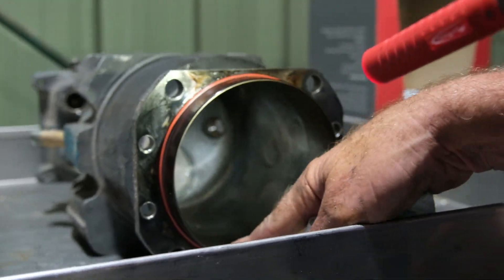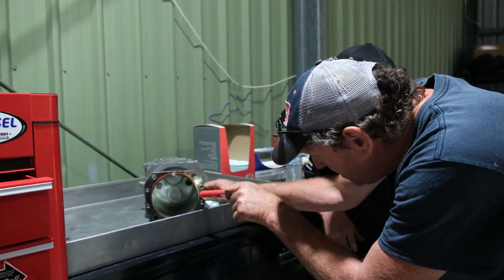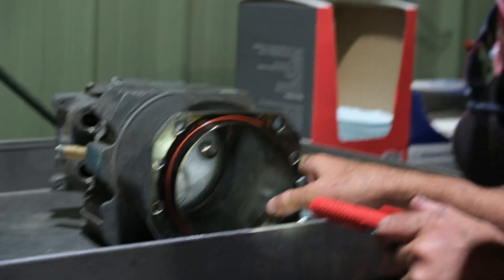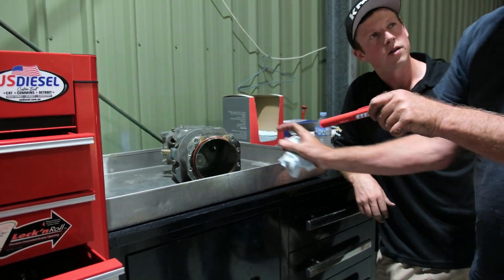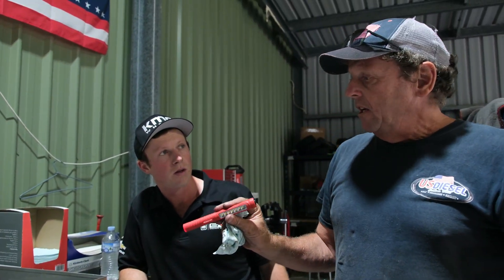The main thing — rather than just being plainly worn out — is the corrosion. There's a tiny bit in there, which nearly every engine has. It's got fine wire plugs top end and bottom. The good indication when you see fine wires top and bottom is that the guy who owned the engine said 'I don't care what it costs, just put the good stuff in.' A lot of guys will only put the fine wires in the bottom to save money.